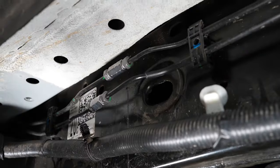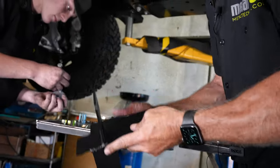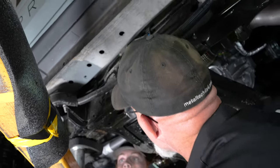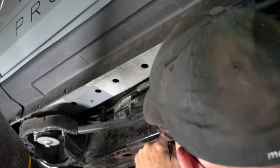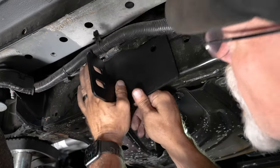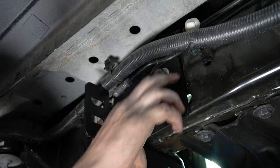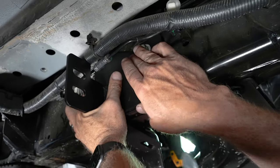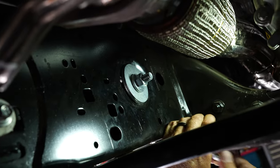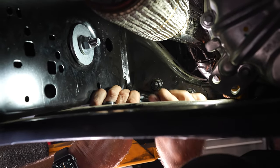You've also got some brake lines here, but your slider will clear those so we don't have to mess with any of that. The Bronco comes with a frame mount for the slider and we're going straight to the frame with the provided holes from Ford. It's been designed so it slips right up after you've already loosened this wire loom — it slips right up behind. We're putting our bolts facing up to protect the nut, going up through our frame mount into the Bronco frame, with a washer, bolt, and lock washer on top.